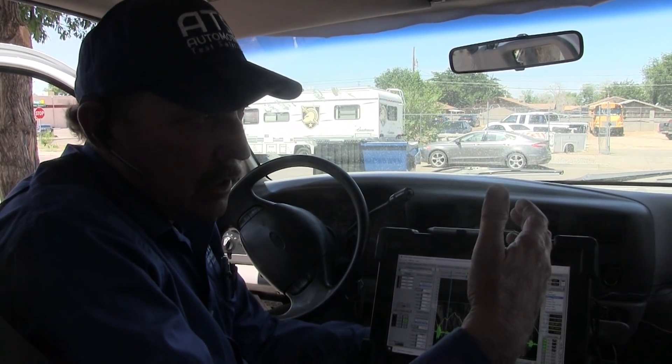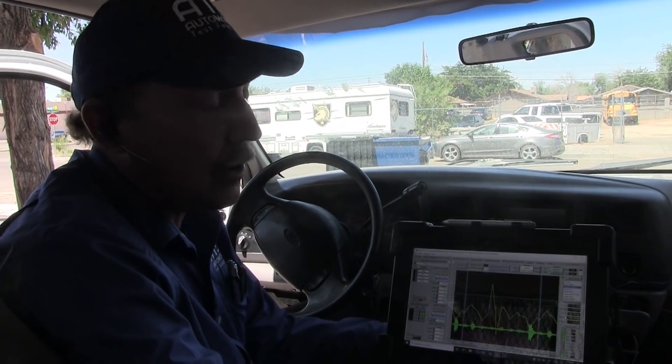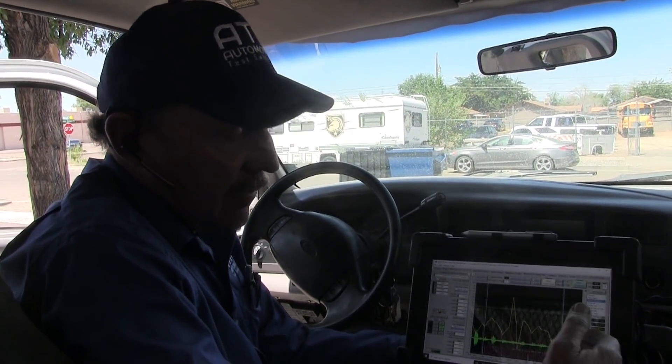The knock sensor — I've been using this for a long time. On these diesels it's a really powerful tool because I can also zoom in and look at these others to see if one of them might not have fired or if I've got a knock like this. So we're going to turn this truck back over to the shop and hopefully you guys can start to use some of the technology like the crank velocity changes and the knock sensor, and you'll have good troubleshooting in your base.